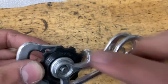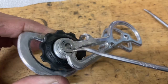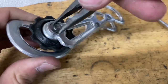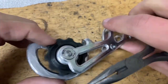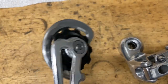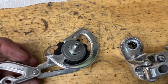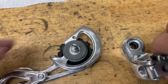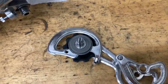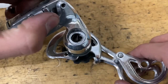Make sure your pulley is greased up and everything is all nice and greased up. Then put on your little nut retaining thing. Tighten it down using a pin spanner or pliers to make sure it's really on there. Make sure your pulley spins smooth and that the little plastic thing spins smooth — you could also use some oil on here. You want it tight, but not too tight; just make sure the plastic seal moves nice and good. Some seals have a little notch to match the spring, but this one doesn't — if yours has it, make sure to line it up and then slide it on.